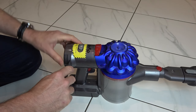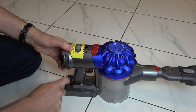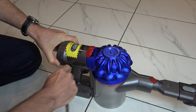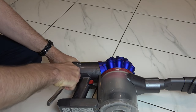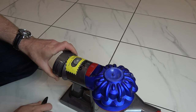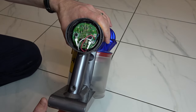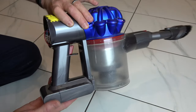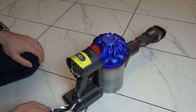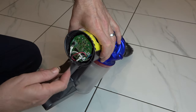I'm just putting it in this part here and gently starting to lever it out. It's very hard to get into. There we go — the bottom is unclipped, and now hopefully the top — there we go, the top should come out there. So that's the electronics at the back there, don't touch any of that. Remember you've still got power going in here because the battery is still connected. If you're nervous, you can always take the battery out to make it safer, but if you're careful and don't push it in too far you're not going to touch the electrics on the inside.